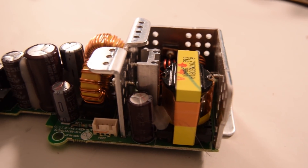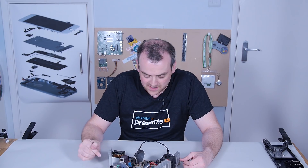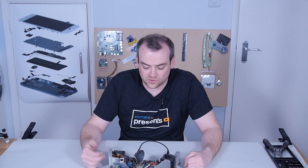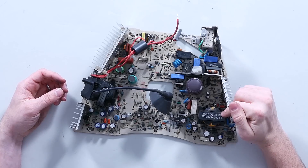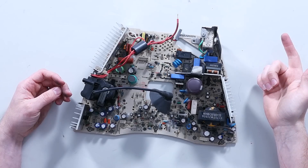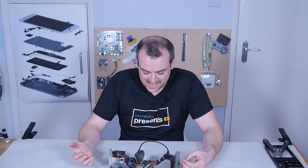Any issues on the high voltage side means it's likely to start interfering and potentially damage the logic board as well — I see that as a weakness in the design. Otherwise this is a very simple power supply, DC-to-DC power quality and conversion. One final thing on the high voltage side: some of the audio amplification actually comes from the HV board. The speakers are driven from the logic board when turned on, but as soon as you press the power button and start the boot sequence, you get that distinctive Apple chime sound, which has to be derived from this board. So this board handles the incoming power supply, the CRT power supply, and audio amplification — there's a lot going on for an analogue HV board.